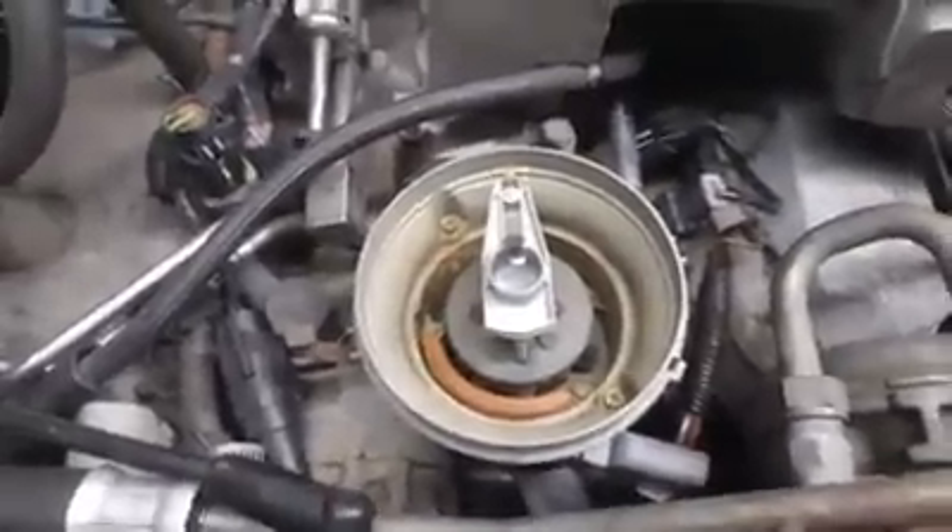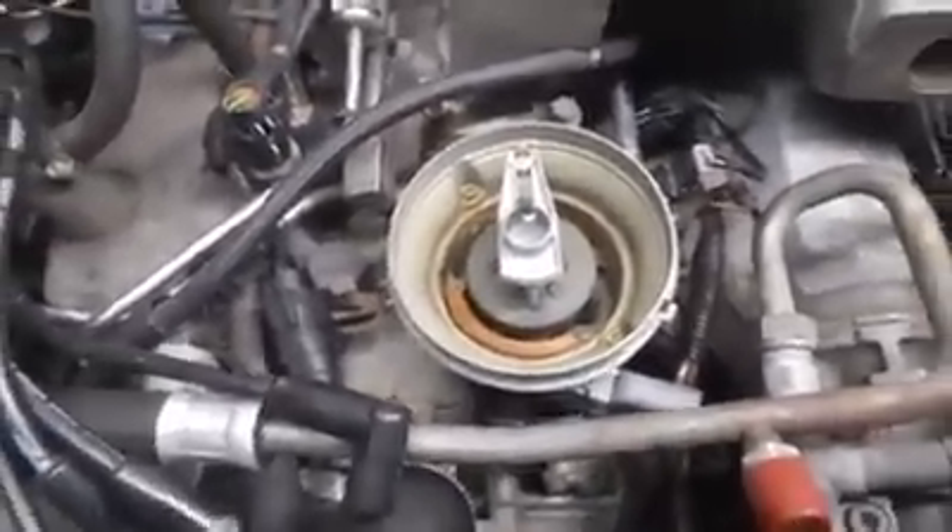The hard part is how do we deal with the timing specifically — not just where the rotor starts. The motor has to be at top dead center on cylinder number one compression. I don't know if I can get you a shot of this because there's a bunch of supercharger stuff in the way. I've marked the crankshaft with a gold mark and it's really buried.